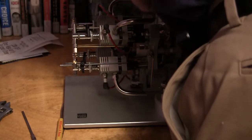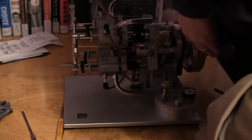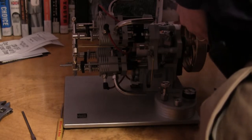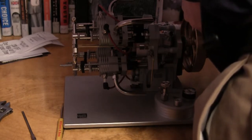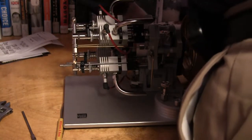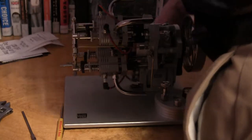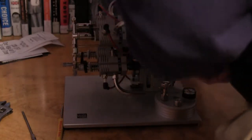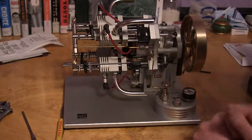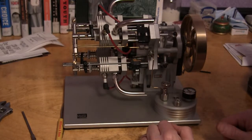It's much easier to diagnose what's wrong on each individual cylinder. So don't be afraid to disconnect all of the 3 cylinders and work them one at a time. If you can't get it to run at all, you work it one at a time. And if you can't even get that one to fire, or any of them to fire, check spark. This little piezoelectric element doesn't last forever. They last a long time, but every once in a while one will fail.